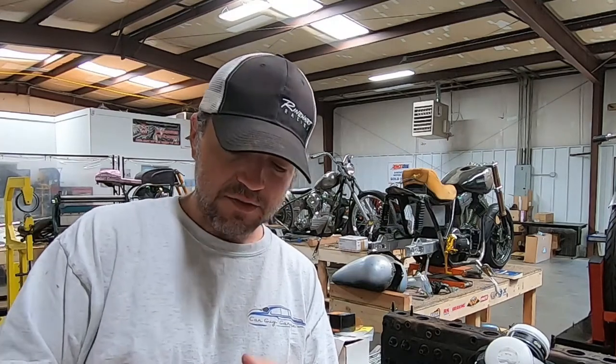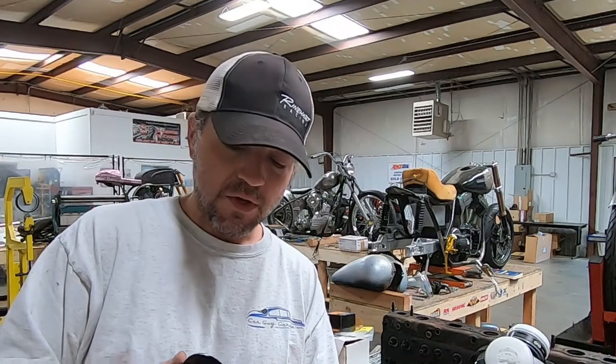I don't think that could have worked out better. I'm very pleased with how this turned out, and we were able to save the crank, which is awesome. You'll notice when I slid that thing on there, it stopped just a little bit. I put a very small amount of taper into the hub because I wanted about a 2/1000 interference fit once I slide it up on there. I haven't cut the keyway yet. I'll do that off camera; there's nothing too exciting about cutting the keyway. I'll cut the key for that, and then this hub and that crank will be saved.